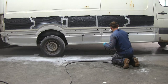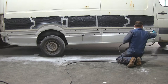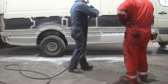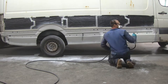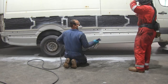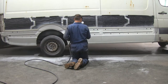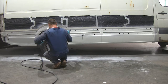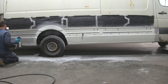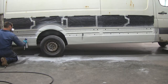I have a next-door neighbor called Dima who sprays cars pretty much all the time and uses Gravitex as his anti-chip solution. I've seen the results and quite liked them, which is why I chose this material. Later on you'll see several different application methods — one is spraying out of the standard gun as you see just now, and there is also a specific gun designed for spraying Gravitex. It works on the same principle but looks slightly different, and the finish is quite different — much rougher with a larger grain texture.